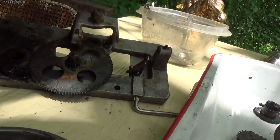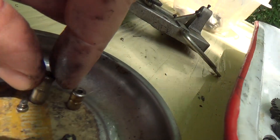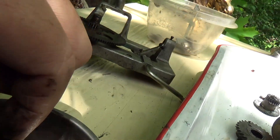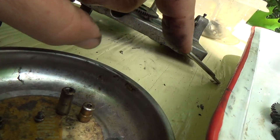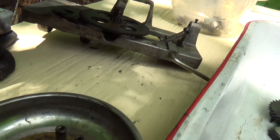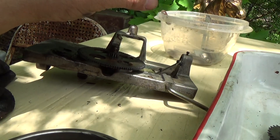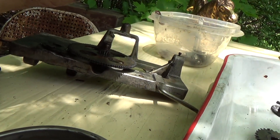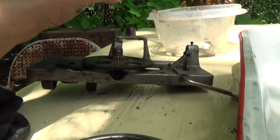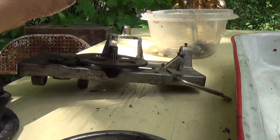This side — which is the longer, or sometimes they're the same size — has no groove. This is adjustable. That's how you adjust the lash on the governor: by moving that bearing in and out. The trick is you want a little tiny bit of movement — just a little bit. Not a lot and not too little. Too little will bind it; too much will have it slapping around. This is something that comes with experience, but you'll get the hang of it once you've done a number of these motors. I will show you when the motor is reassembled.